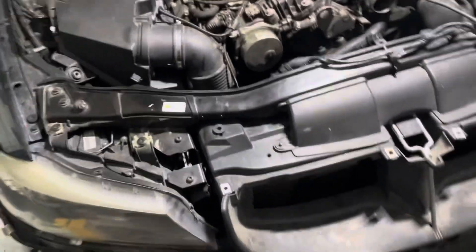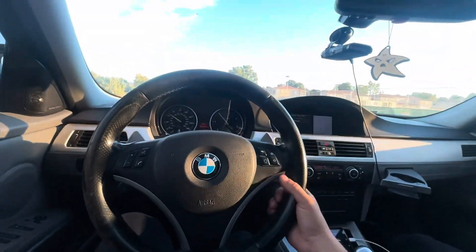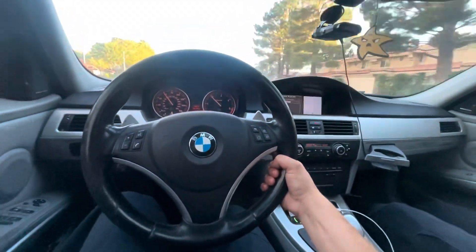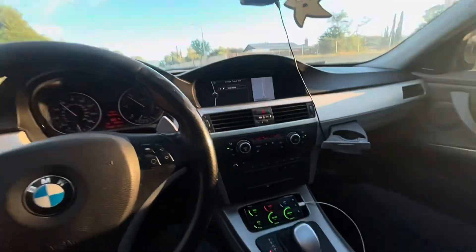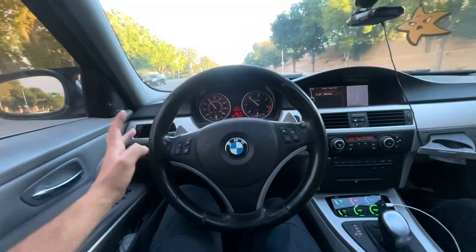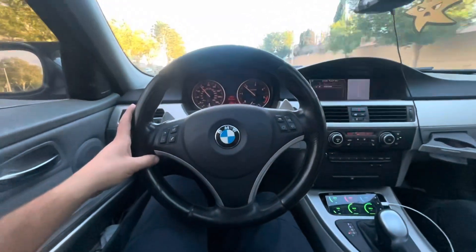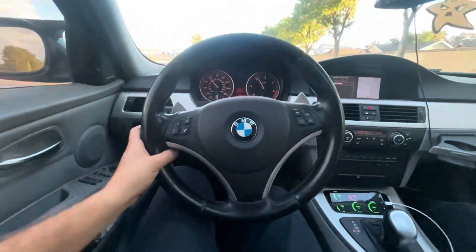She's been test started, everything is buttoned up, we're good. Going to throw the e-fan back in and check for lower IATs. Doing some POV driving now — it's about 6 to 7 o'clock, 90 degrees outside. Got Pro Tool open. Cruising around 60 mph showing about 100 IAT on the intercooler. Pretty sure that's better than before — I'd really have to log my X5 since it's still stock to compare, but I vaguely remember seeing 140 to 150 IAT with the stock intercooler.